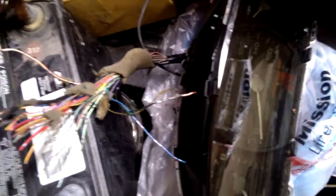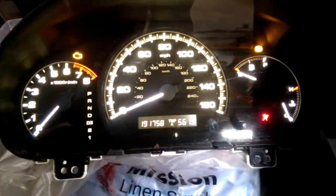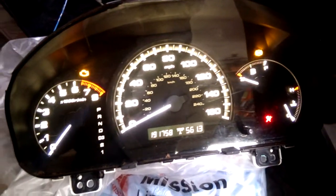There's no way to put a check engine light on this stock ECU. So I got this cluster — I'm hoping it'll work. I'll power it up here so you guys can see it. It's like a white face — I think that looks pretty cool. This is actually the original mileage for my motor too, so I got like the original mileage on there — 191, which ain't too bad. I just have to ground for the airbag and the ABS light to turn that off.